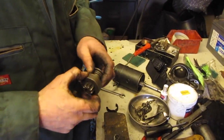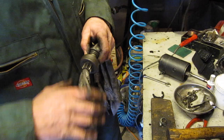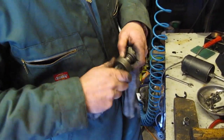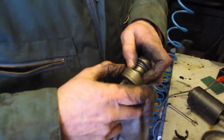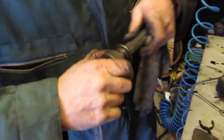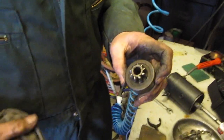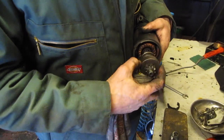This is a one-way clutch and the gear piece. Just give the centre of that a clean — I don't want to wash this in the degreaser bath because I don't want to get degreaser inside this clutch. Make sure that slips up and down on there quite freely.